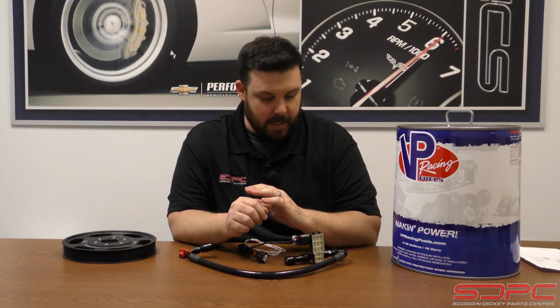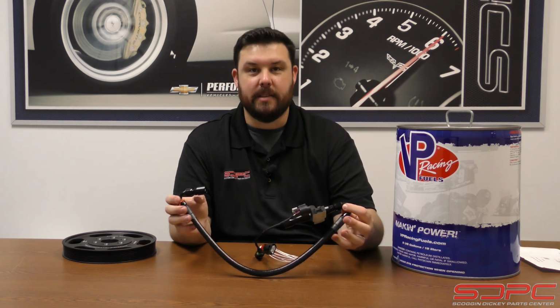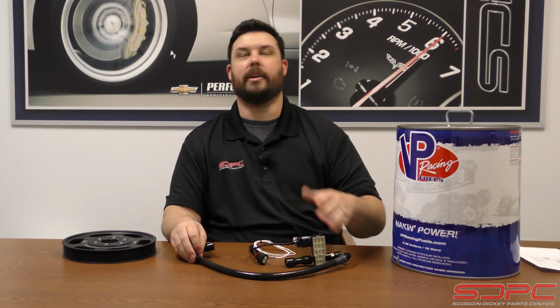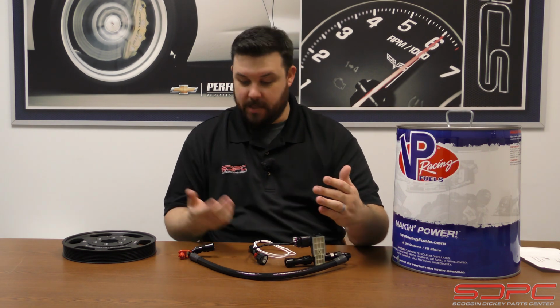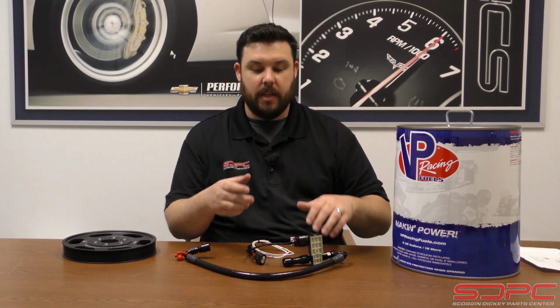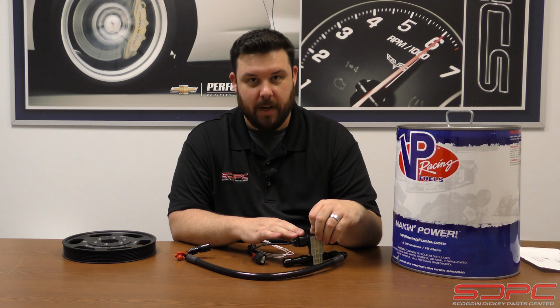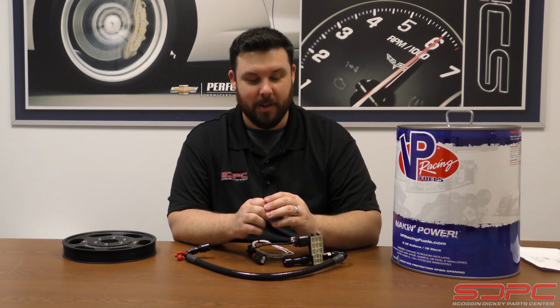And we really like doing business with these guys for many reasons. One of them is they make some really great quality products. And one of the more popular products that they make is these E85 Sensor Kits that are made for all sorts of cars, whether you're doing a C7, this is for a 6th gen Camaro, a 3rd gen CTSV, stuff like that. These are a great all-inclusive kit to add a E85, a flex fuel sensor, to read E85 into your car, tune it so you can get the benefits for some of y'all that can run some corn.